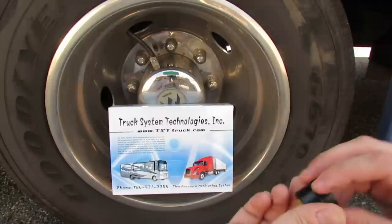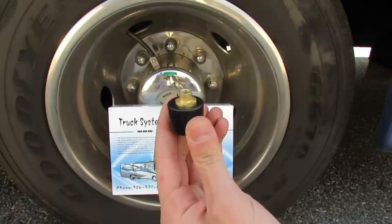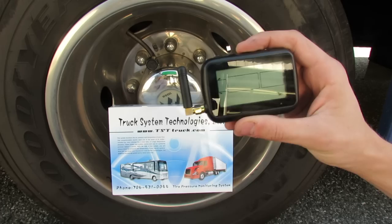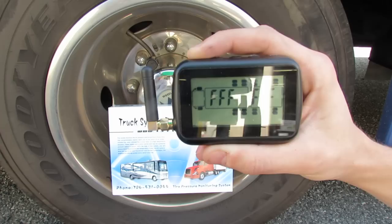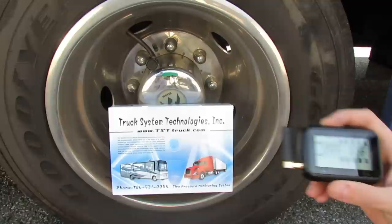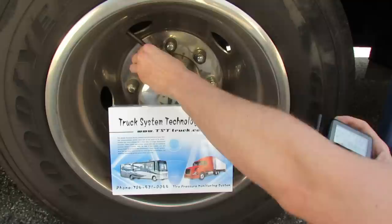Matt is now going to demonstrate the ease of installation of a single sensor. Before you set your sensor onto the valve stem, you want to make sure your tire pressure is compliant with what your tires are supposed to run on — so if you run 100 PSI, make sure it's at 100 PSI. Take your 507 sensor and barely screw it onto the valve stem, letting it sit on the valve stem but not engaging the Schrader valve. Take your monitor with the diagram of the truck and press and hold the set button for nine seconds until it beeps twice. You will then scroll using the plus and minus buttons to each tire you want set onto your program — for our system, we're using the outer right dually. Press the sensor onto the valve stem, screwing it on snug but not tight.